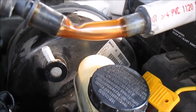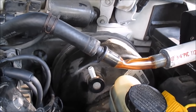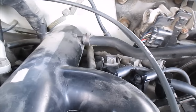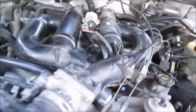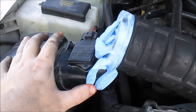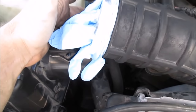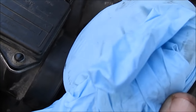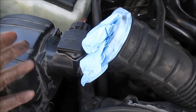Some of these fittings are kind of loose, but anyway, it goes into my brake booster vacuum line, into my intake. I'm just going to smoke out the intake. What I did on this end — because your intake is open — I disconnected it just before my MAF sensor and I just stuck a good rubber glove over that.